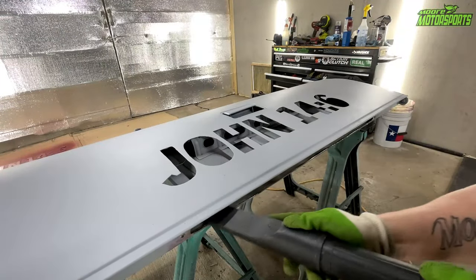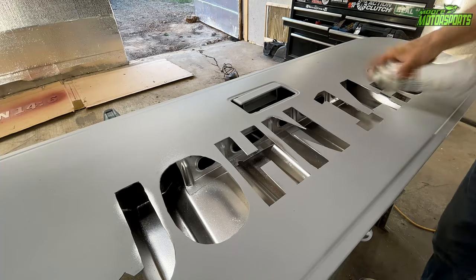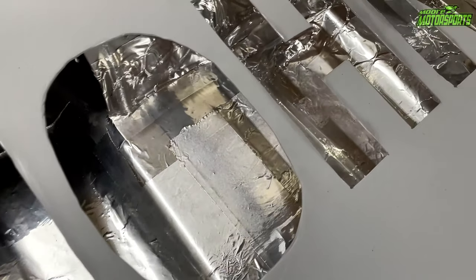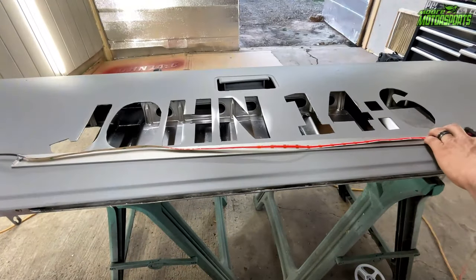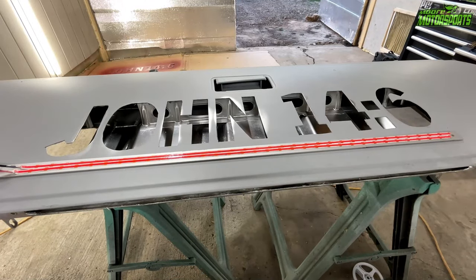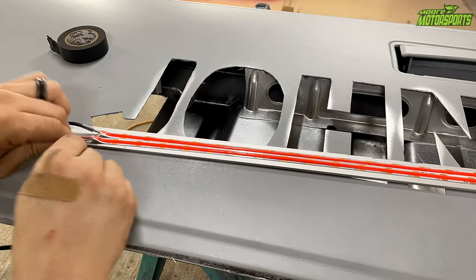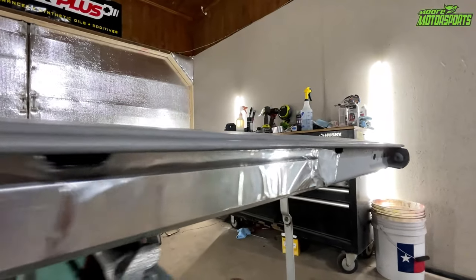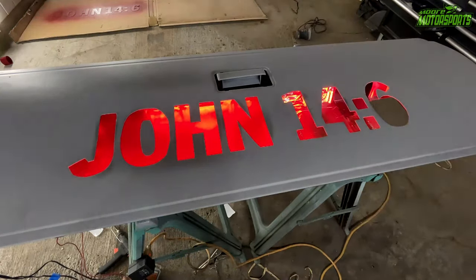After I got the cut made, I vacuumed out any dust or debris on the inside and cleaned it up. I used some silver metallic paint to brighten the inside so the light reflects more, then ultimately went with HVAC foil tape — it adheres well and it's really bright. I laid out the LEDs on the metal strip, cut them, and did two strips plus one more. The two strips are for the brake light and the single strip is for park light since I need it brighter. I put foil tape around the bottom so no light leaks out, but there are still holes for water to drain. This is what it looks like with the park light on, and that's with the brake light activated.